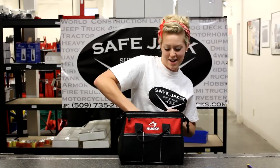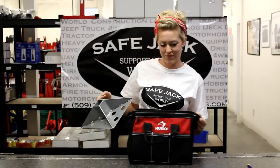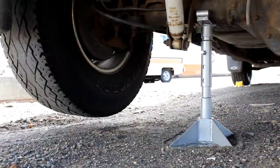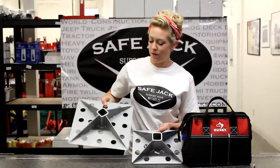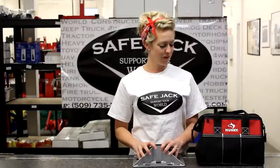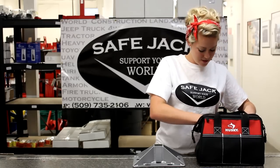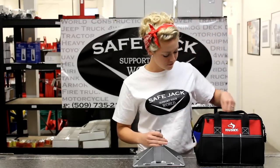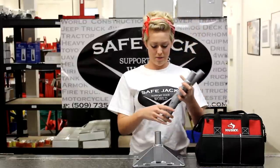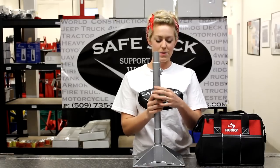The compact jack stand is only two and a half inches thick for easy storage. Its base is large enough to support most vehicles on soft terrain. If you have a larger vehicle, you also have a 12 by 12. Let me show you how it works. We have a jack kit for supporting the vehicle that fits right into the jack stand. Because of this system, you can go as low as five inches or as high as you need using as many extensions.